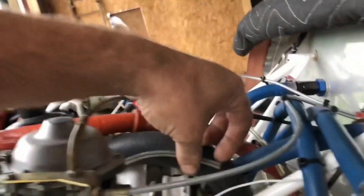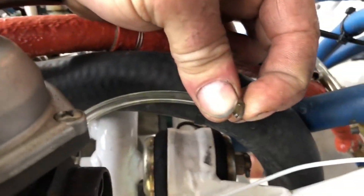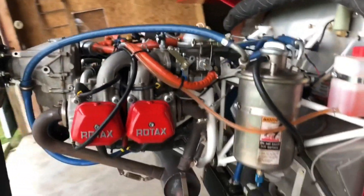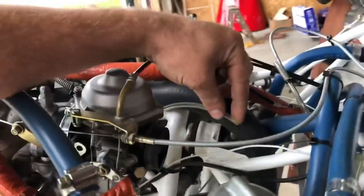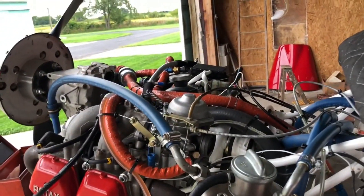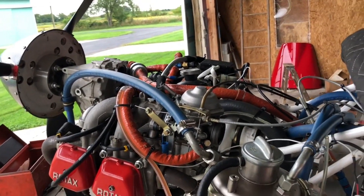If you ever do any motor work, Rotax says to put them right here in the side — tuck them in there. I did the longer routing just for a test flight. These when you tuck them in there they get really small, so I'm not sure they'll fit, but I'll try. After I clipped these and put them right here by the carbs, we flew it and it ran perfect through all RPM ranges — good power, a lot better power. It runs amazing. Just a quick tip.